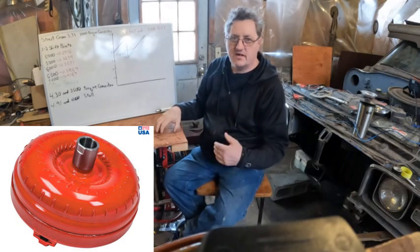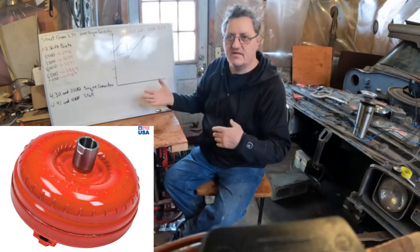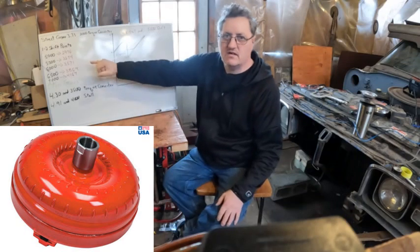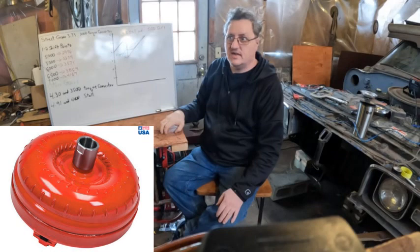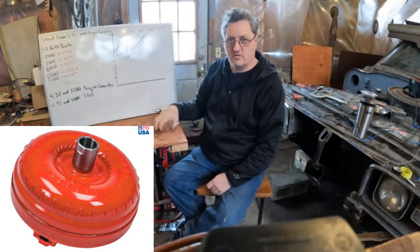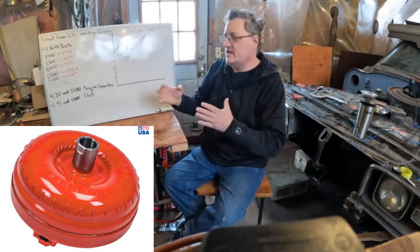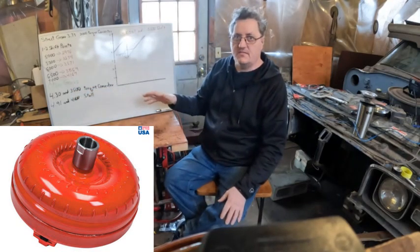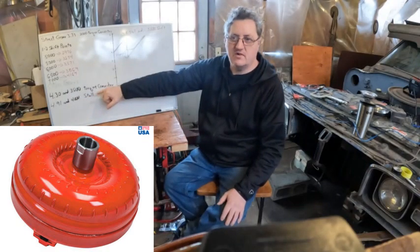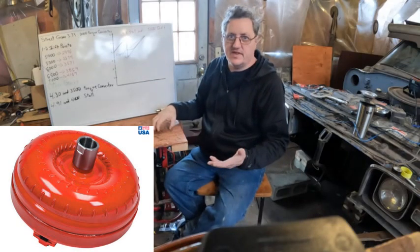I've calculated out these combinations to make it easier without having to go to the calculator yourself. If you're shifting at 6000 RPM, this shows 3571 — so a 3500 converter would work great. Down here I've calculated that a 3500 torque converter and about a 4.30 gear would work really well; a 4.10 gear is pretty close and it doesn't have to be exact to the number. Going up to a 4000 stall, the calculator gives 4.91 — a 4.89 is a common one you'd see listed when ordering a rear end or ring and pinion set.